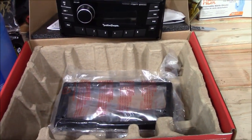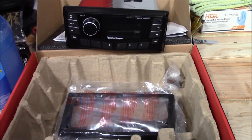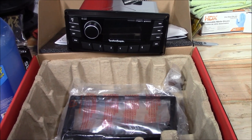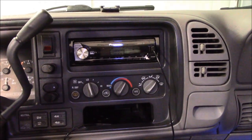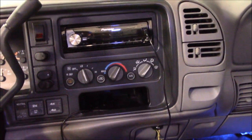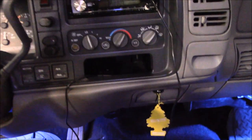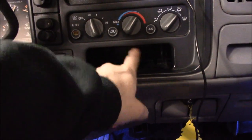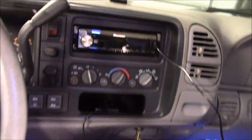This is going to be an unorthodox way to solve the whole problem I've got with my stereo — I don't want to go through the trouble of hacking in a full double DIN, and I don't like single DINs because they don't look right. This Rockford Fosgate deal — much better quality deck — and with a rear USB I don't have this cable hanging out front. I hate that. I've got a hole drilled up in there for the USB to come out so the iPod can just sit in the pocket.